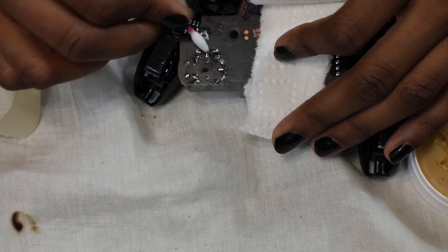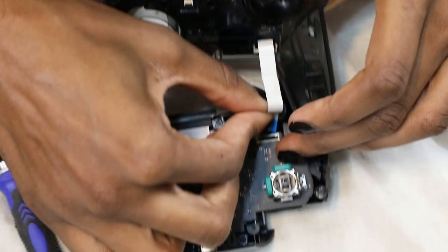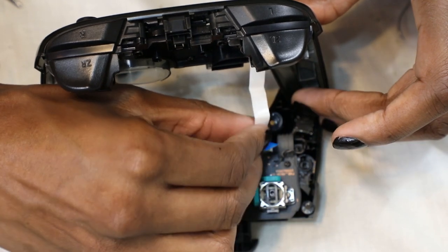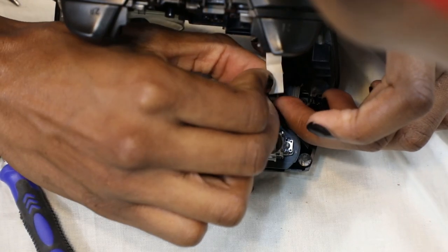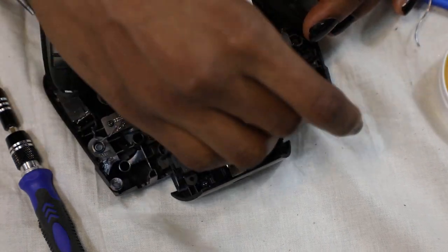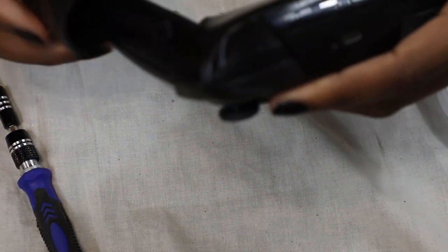After that I attach the motherboard back to the controller and reattach the ribbon cable. It's really hard to get it visible on camera, but you're just sliding that ribbon cable back into the slot and snapping it closed with that little black flap. Now I'm going to reattach the analogs and put the shell of the controller back together, but I'm not screwing in any of the parts yet — just to make sure the controller works and I don't have to take it apart again.